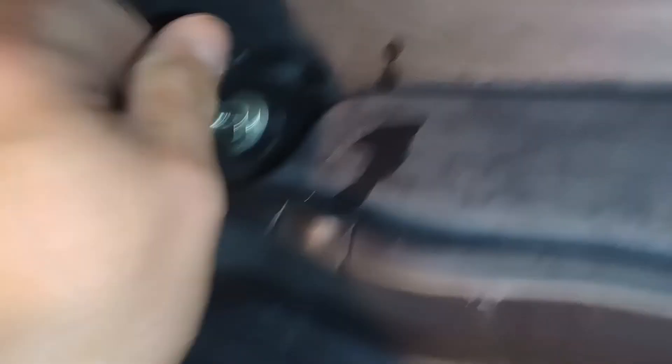Alright, so now we've got everything but the wiper arms. I've placed the passenger side on — it just sits right there onto this nut. What I really should have done is used a pen or marker to put a mark exactly where it was, but it's not really hard to readjust later. So now that's on, you take the nut and put it back on the stud. I'll finger tighten this, and then check the fit. Let's see if I can do the second one.